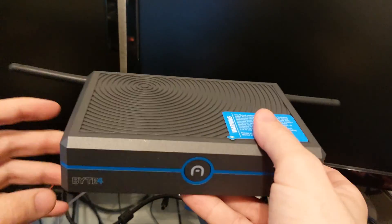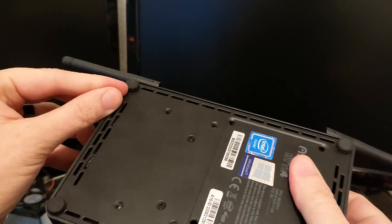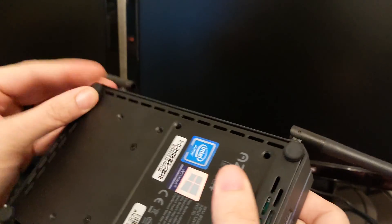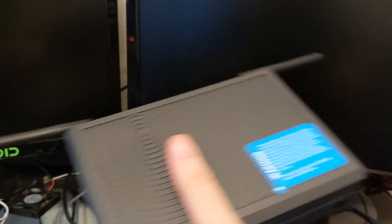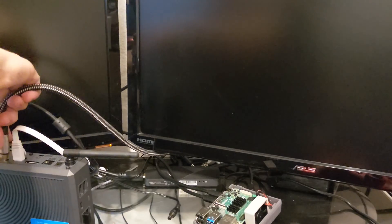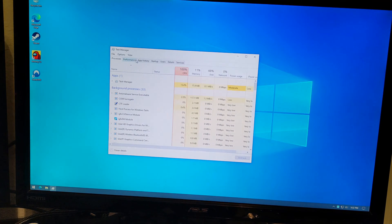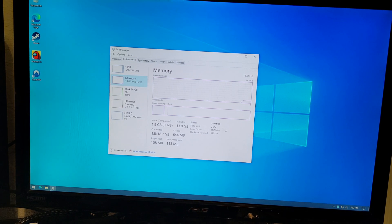This is my Pixel 5 recording. I've got it all back together — remember these feet are not something you just pull out, you have to physically twist them. Now let's plug it all up. Before, it said one stick of four gigs in single channel. Now let's open Task Manager, go to Performance, and we see two of four slots used instead of one of four. And now we see 16 gigs. Look at that — it clocked down to 2,400MHz instead of the 2,666MHz, but that's okay.